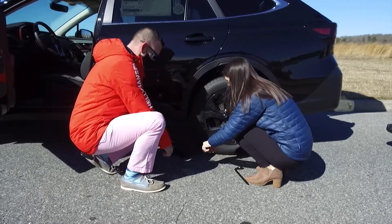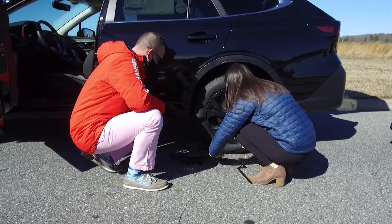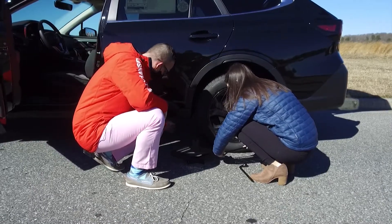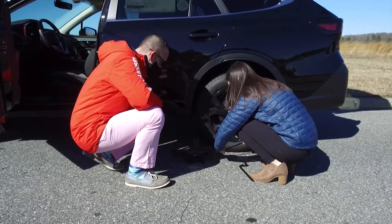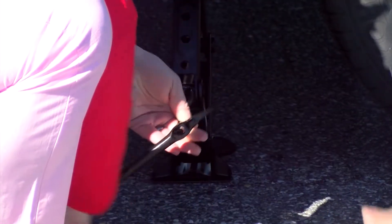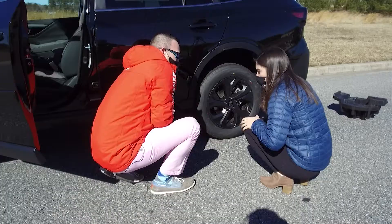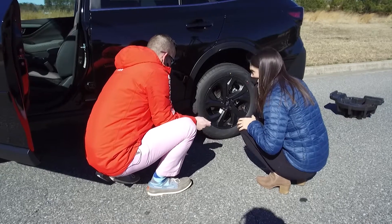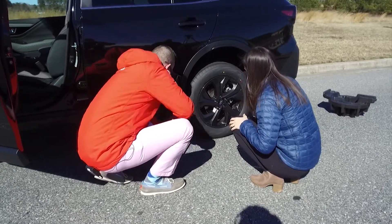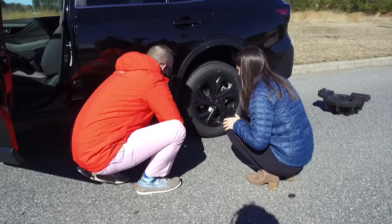Just make sure — so I just keep twisting it until it gets, you know, you can feel it up in there. And how do you know when it's done? How do you know it's up high enough? General rule of thumb for me is the paper rule. If you can take a piece of paper and slide it in between the wheel and the road, you know you've lifted it high enough. There's no reason to jack it up super high — at that point it can become kind of dangerous.